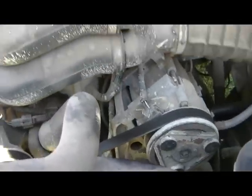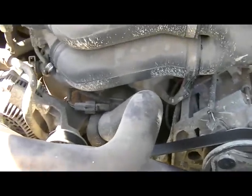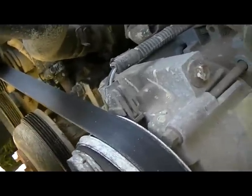Hello, this is Kevin Bacon. We're going to do some cooling system maintenance and repair today. I wanted to give you a look under the hood of this vehicle. You see that stripe across the hood? That is a residue of something that's been thrown by the fan. Look down here and you'll see it's everywhere. My intuition says water pump, and I reach down inside the water pump pulley and come up with a handful of the same stuff. That stuff is stop leak that's been dumped in here over a period of time.